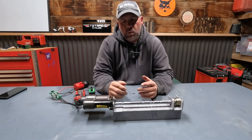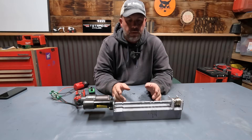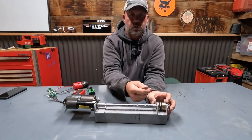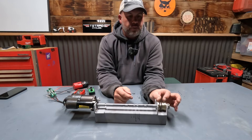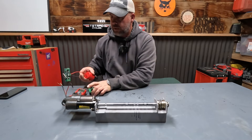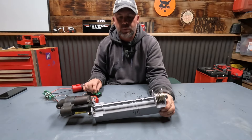To help explain why we calibrate these actuators, I built a little jig here — a mock-up of a control valve with a lift spool. We've got our actuator on one side and a centering spring on the other, because this actuator goes in both directions: move the bucket up, move the bucket down, and the spring will center it. It's double-acting, so it pushes both ways. I've got a servo driver and motor controller so we can drive this actuator in both directions.